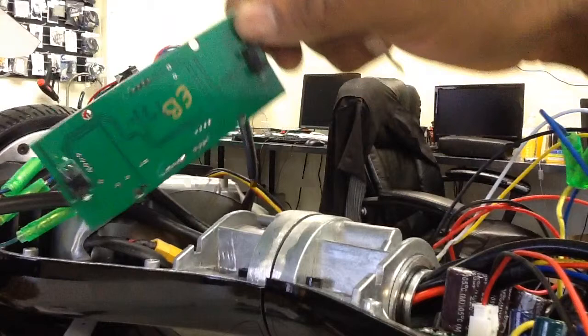Let's unplug this posture sensor and plug in the one that doesn't work once again. Let's turn it back on. See? No response. This is a bad posture sensor. And that's how you test your posture sensor to see if it's bad or if it's good.